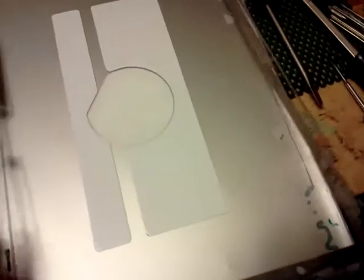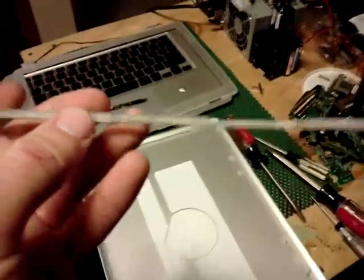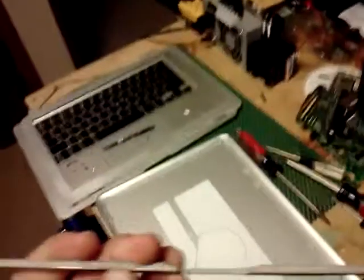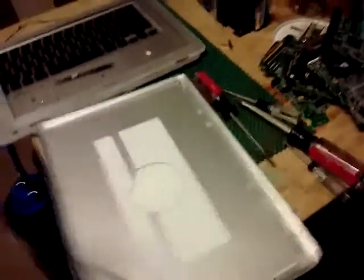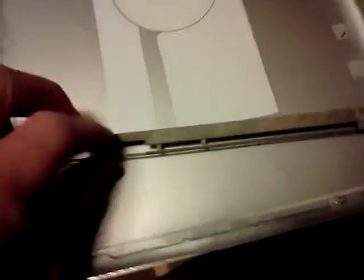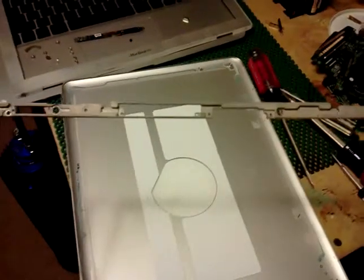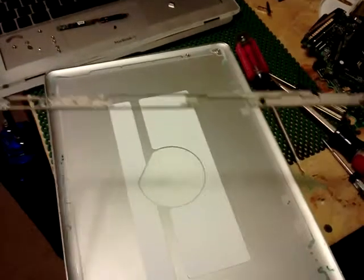As I was pulling it off, I noticed damage from the impact — there's a small portion of the bracket that was damaged. You can see there's a break right there, and another break with some separation that happened here. It should be okay — I'm going to throw some JB weld on it, press those back together, and clean them up with my Dremel tool when done.